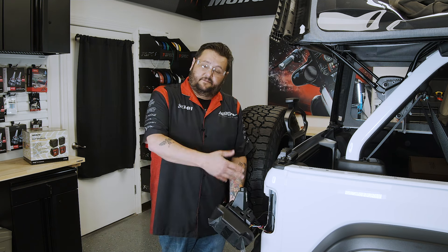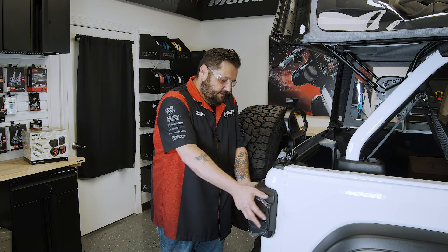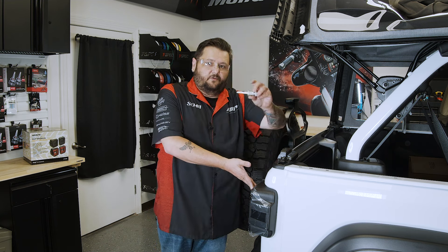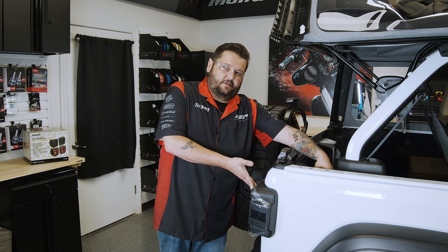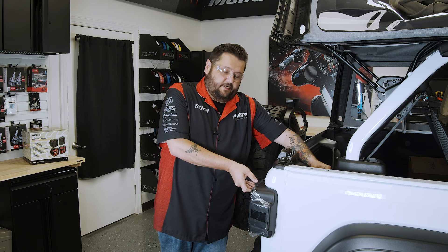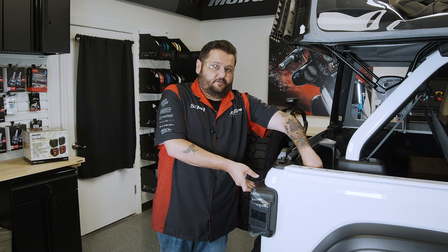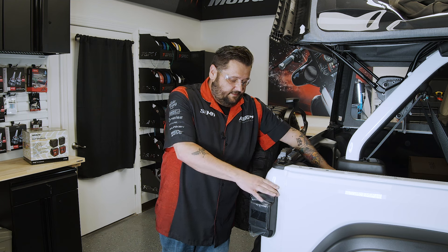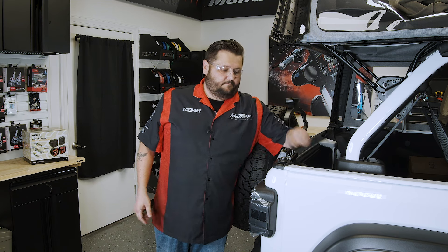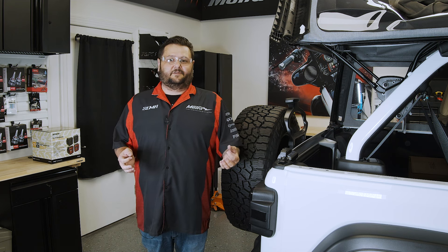Now that the clips are in place, put the harness back together and get the light back into the cavity — line everything up and hold it in place. While doing that, take your nylon bolt, go through the interior hole, and hand-tighten it for now. You'll feel it get tighter as the spring on the nylon bolt compresses against the tail light housing. Pro tip: there's no need to over-torque it because it will strip out on you. Once it's secured, take the cover and plug it back into place.